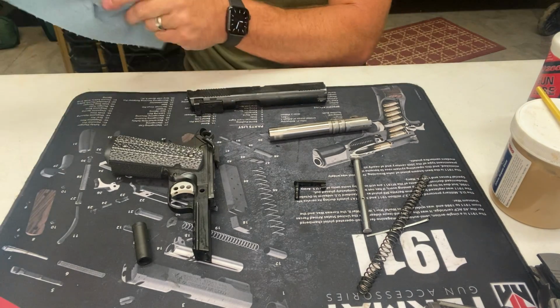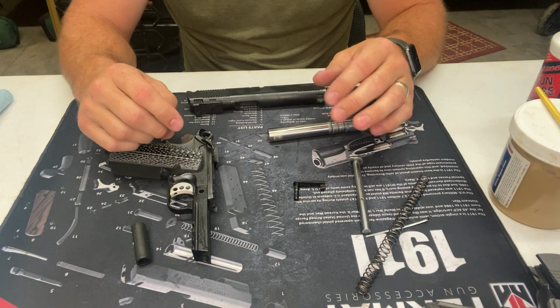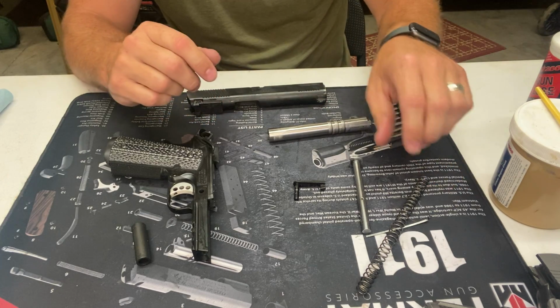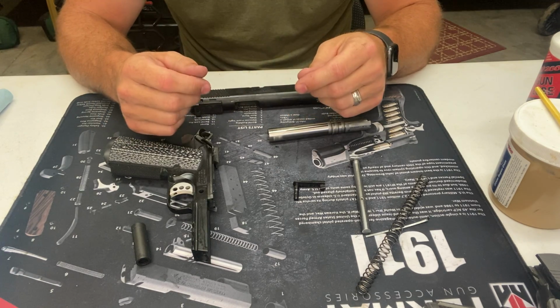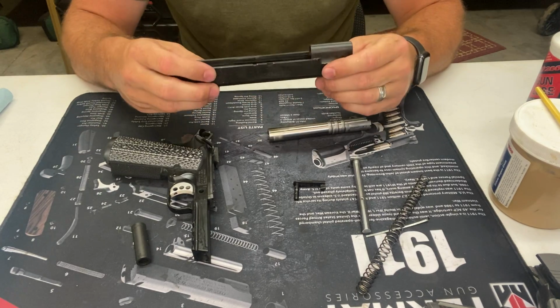That's a big important thing, making sure if you're going to be mixing an oil and a grease that they are compatible, because when I was in aviation school, we learned that planes have been brought down by mixing greases and oils that weren't correct, and they actually turn into an abrasive and not an extra lubricant like you're thinking it does. So anyway, I sprayed all this down.